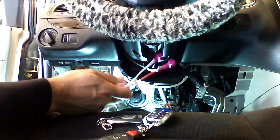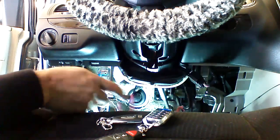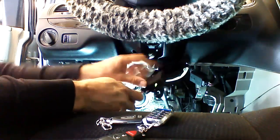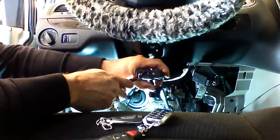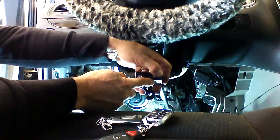If you want optional connections like the parking lights, which I'm going to show you later in the video, you can go ahead and connect these. So we would be ready to program the module. We have the module blinking. It needs to be locked in data mode. So it's blinking one flash. We're going to press and hold the program button. Lock the module in. Light's going to go green and go out.